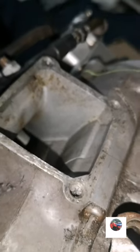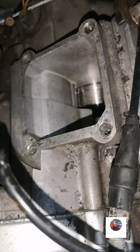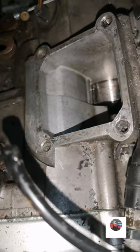That's it out now. I'll just start to clean inside on this. Clean that bit more off. Like I say, I'll put another bit of toilet roll in there and just go around this once more with a scouring pad just to get the last bits off. That's all clean now, ready for the gasket and the reeds to go on.